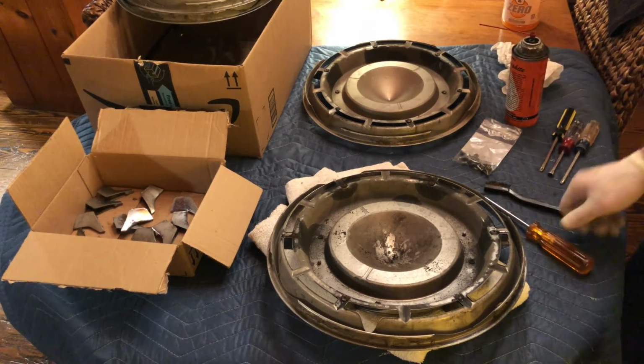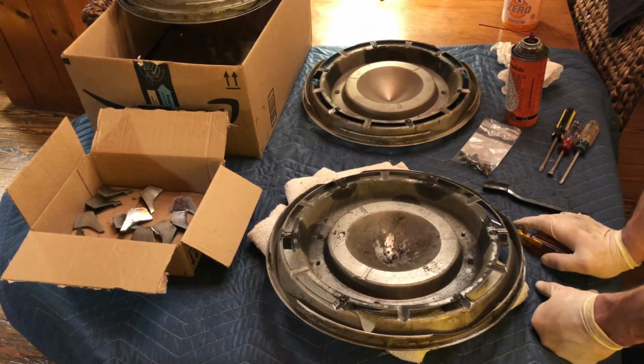And what actually got this off last time was I turned the screw toward tighten because I had a new grip. It was camming out in the loosen direction, but I still had a heavy grip in the tighten direction. So I was able to snap it loose by that technique, but boy, it was close. I thought I was done.